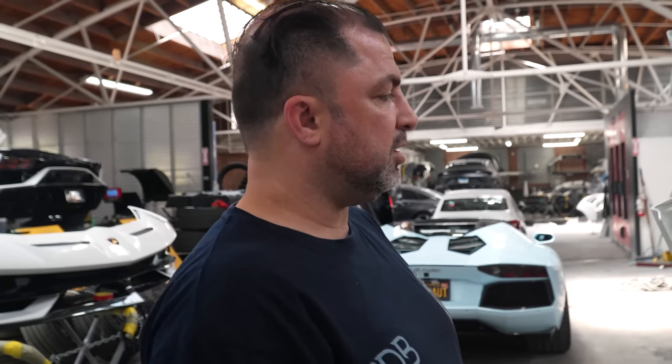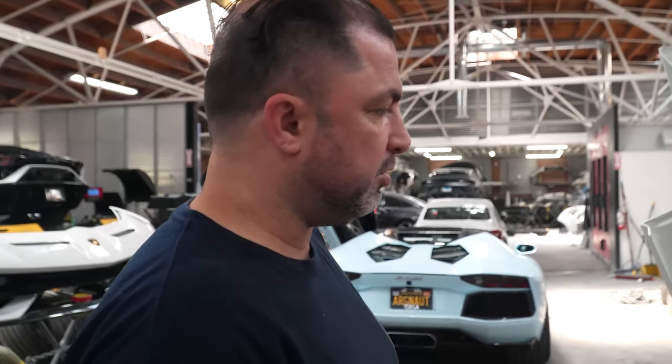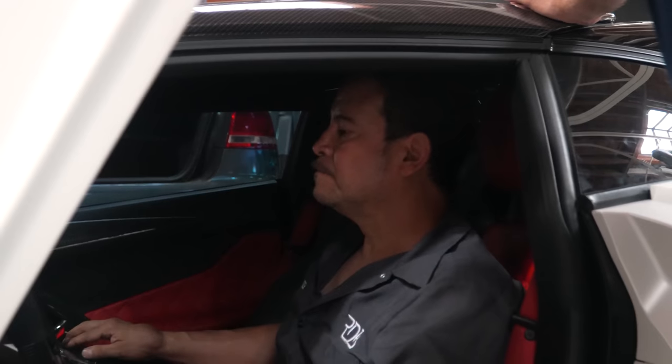We're replacing the brake light switch on this other car — it's almost done. The AC wasn't working and we fixed it. We have one brake light on and a brake light switch malfunction, so we're replacing that, then we'll wash and detail it. Usually a brake light warning indicates low brake pads, a faulty brake pad sensor, or low brake fluid — but it's not going away, which is strange. Javier is doing more research to figure it out.